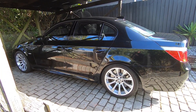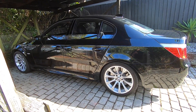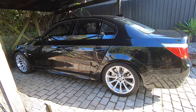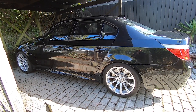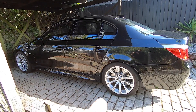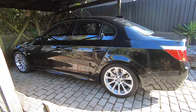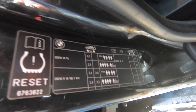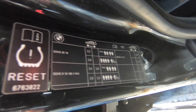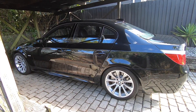Once you've had the low tire pressure warning on your dash, the first thing you want to do is take a walk around the car and visually inspect each tire — it's usually pretty obvious if one is running low or if you've had a blowout. If it's not obvious, use a tire pressure gauge to check each one and reinflate as required to the specified pressures. You can find these pressures in the back of the owner's manual, or on the label in the driver's door jamb, which gives specifications for different scenarios — number of occupants, wheel size, and tire size.